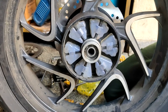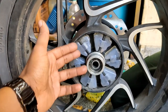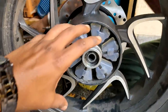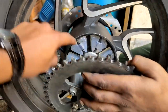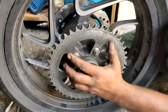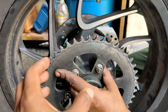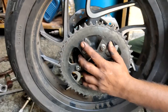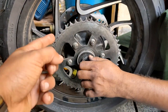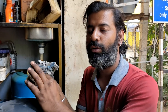One more pointer — you see these rubbers on the rear wheel hub? Over a period of time, every 5,000–10,000 km or whenever you feel a jerk when you engage first gear — the tire stays but the chain jerks — those rubbers may be worn out. Look at this: there's a small amount of play here, but when the rubber is worn out you'll have much more play. Make sure to change those rubbers when needed. Don't take the connected six-piece type like on the NS200 or RS200 — take the separate rubber type.